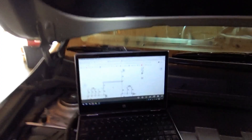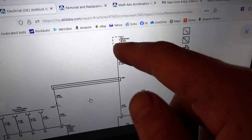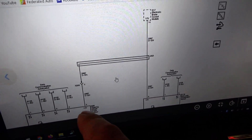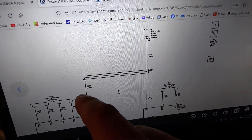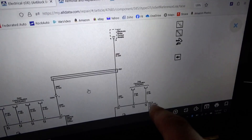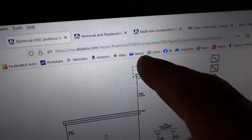The next logical step is to get to the EBCM and put a probe right there to make sure the signal is also dropping out at that point. The steering wheel angle sensor signal could have a bad connection at X200 pin 7, but the multi-axis acceleration sensor — that's a straight wire — is also dropping out communication. Suspecting the 12-volt driver in the EBCM is intermittent.